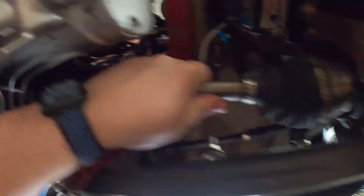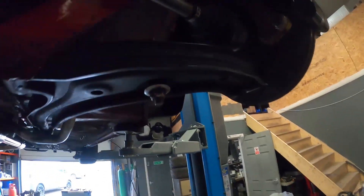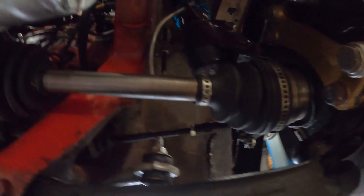Right, that's confirmed it. Now we've put this plate back in to protect the flywheel, there is bugger all movement in that shaft — not even on the circlip retention groove, which the other side we've still got. So I think that's definitely the problem, and we'll start modifying the shaft.